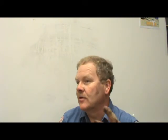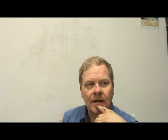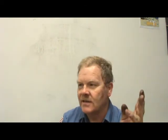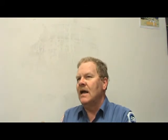Some of you guys who are hot rod savvy might even remember that some of the hot rod distributors would have two sets of points in them. I had a Mustang with two sets of points in it. The reason they had more than one set of points is because you cannot increase the dwell time with a single set of points as much as you can with two sets. So you want to saturate your coil longer so you have a stronger spark. So basically number five is truly increasing the dwell time.